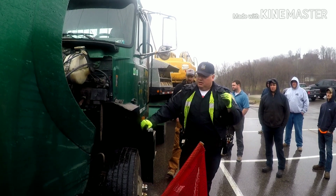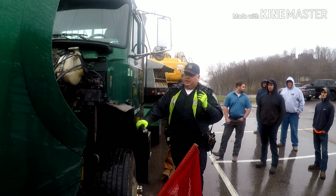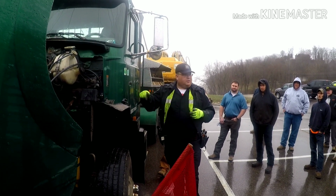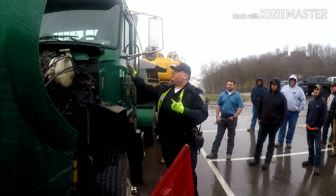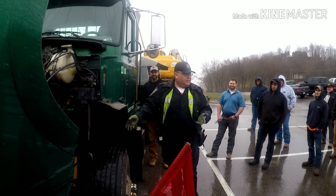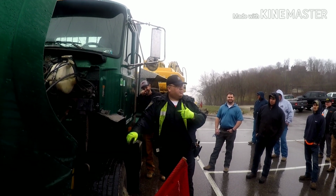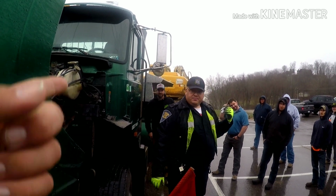And once in a while, have somebody in the truck put their foot on the service brake, and walk around and listen, because a lot of times that's exactly what we're doing. Hey, driver, can you put your foot on the brake? All right, he's got his foot on the brake, and we're listening. Is there any air leaks, anything like that? Once in a while, have a buddy hop in your truck, put their foot on the brake, and walk around it. Hey, do we need to go ahead and check this one while we're... Yeah.